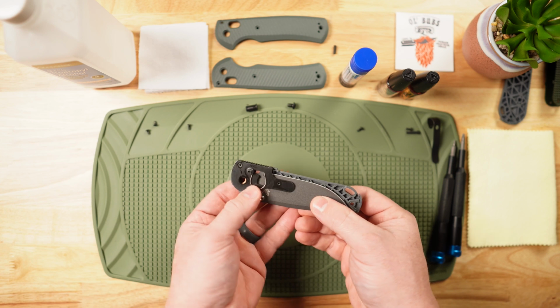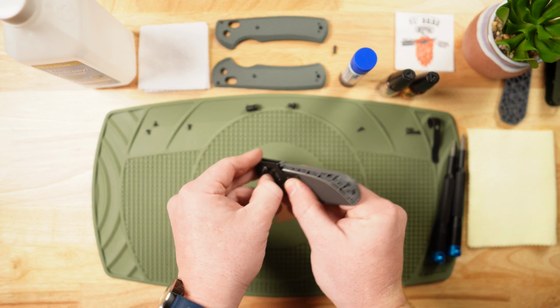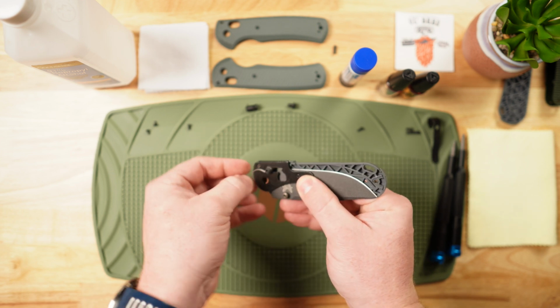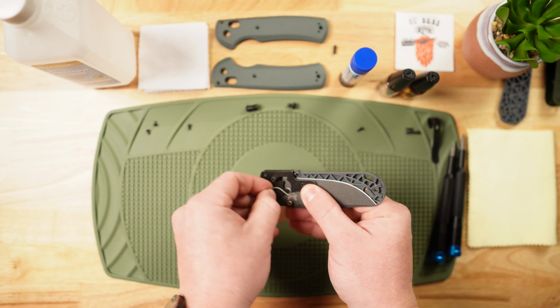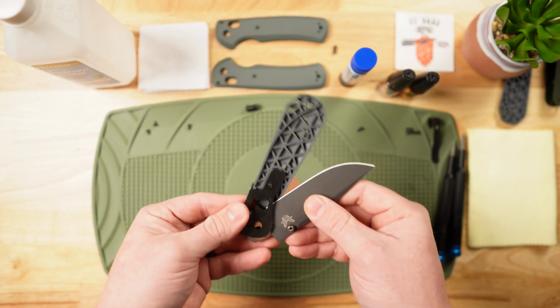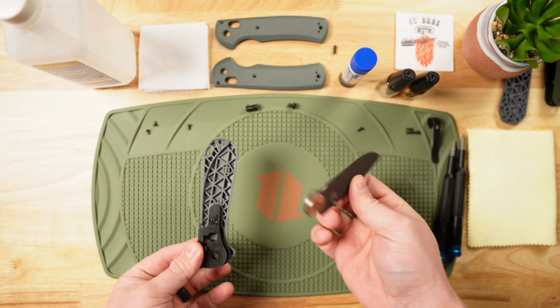Now really careful because you have an open blade here. Just going to undo the omega spring and lift that off of the post here. Set that to the side. Then we can go ahead and just take our blade out here. We've got big washers on this one.